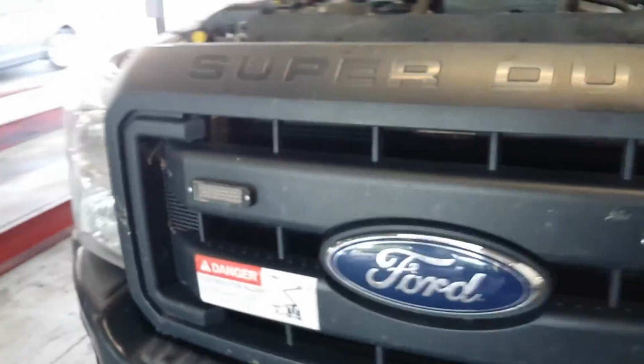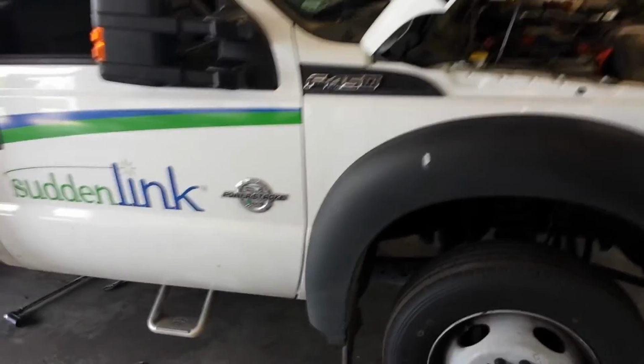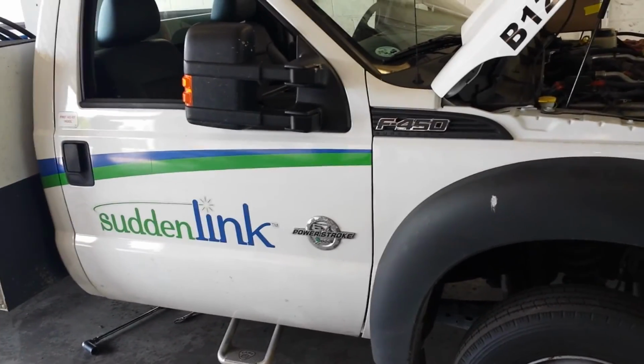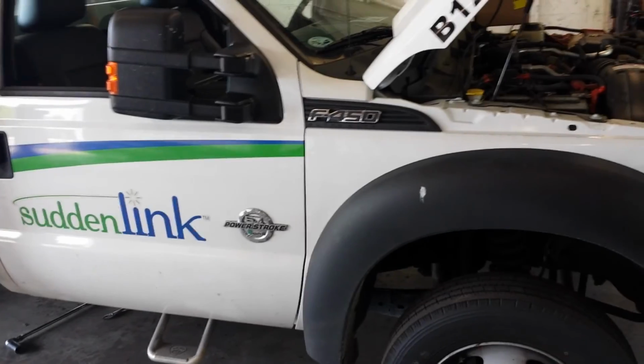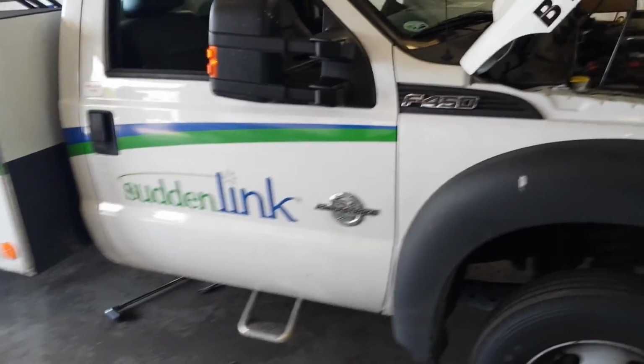So what am I looking for now? Basically, I'm gonna take my phone with me obviously because I'm gonna go drive this truck. But the biggest thing I'm looking for is, does it run smooth? Does it start to skip? Does our fuel pressure actual drop off compared to what the desired is? As long as they match and keep up with each other, then it's okay.